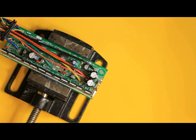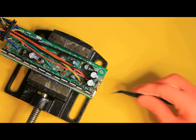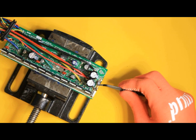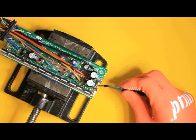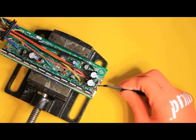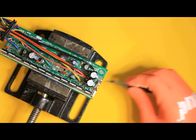What we're going to do today is shunt mod this device. All you need to do is pin these two shunts together and solder them, and that will help bring more amperage when you're using the throttle, going up hills, or anything like that — it gives more amperage to your motor.